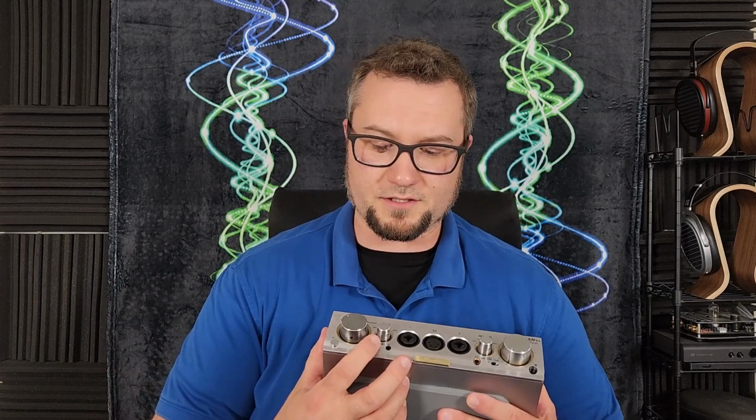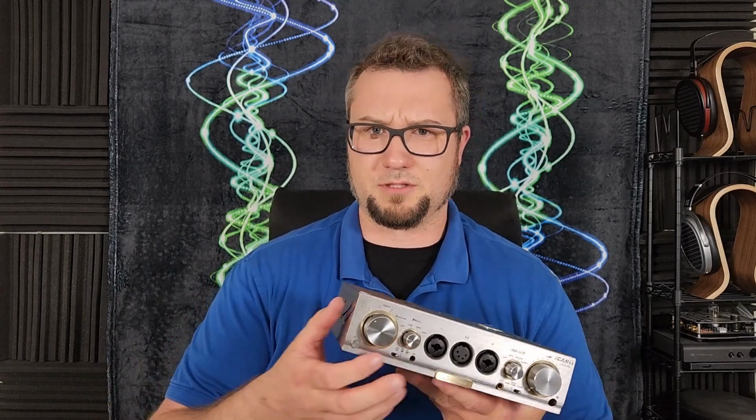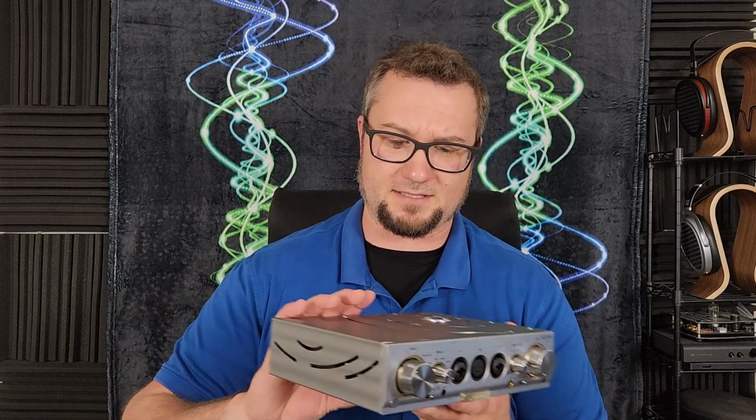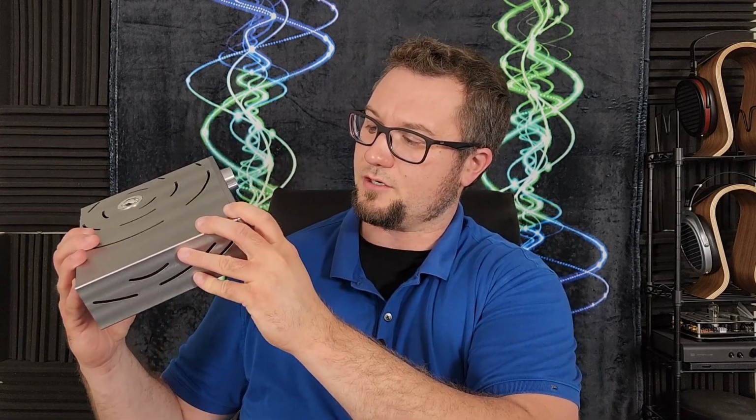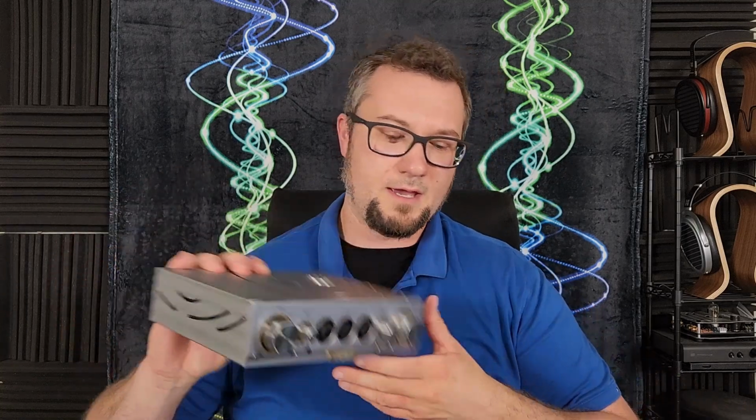And the way this works is I believe it is a 12 decibel bump increase in bass output that is centered on either 10 hertz, 20 hertz, or 40 hertz, or is off. Meaning that you'll get this hump in the frequency response that I believe is 12 decibels high, and the center of that hump is on any of those frequencies that I just named. So it's not really that you get to increase the amount of bass by a specific amount that you want, it's that you get a parametric increase, and then you just move where that amount is centered.